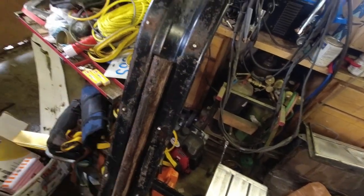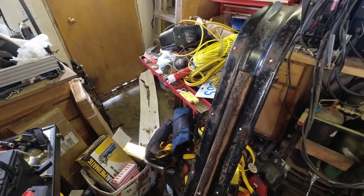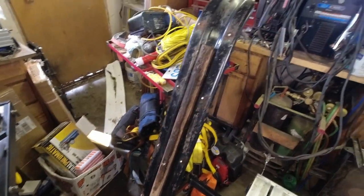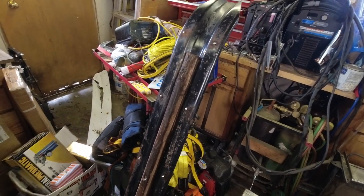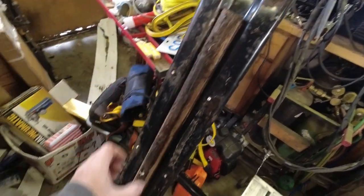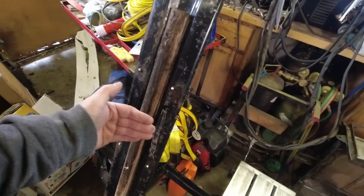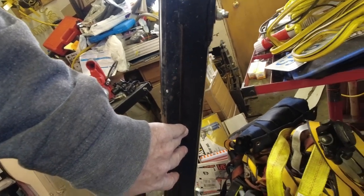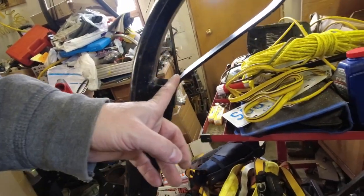What these skis are is a — I'm not sure what the title was — bob sled ski or bob ski, ice house ski that I ordered in from eBay. When I ordered them I think they were like 160 bucks for the pair. I've definitely done some modifications here. You can see this piece of oak that is being held on the middle of the ski that kind of creates the V-shape in the plastic. On this side you can see this inch-and-a-half by inch-and-a-half square tubing that we've got stitch-welded along the top of the ski to add some additional strength.